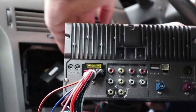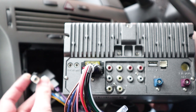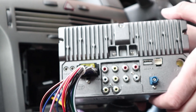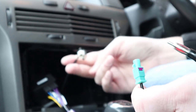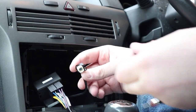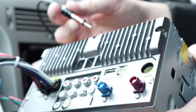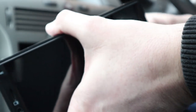On some units you'll probably need to get an adapter for the aerial to fit your car's stereo, and I managed to get an adapter for mine. The aerial connector goes in between - that bit from your car plugs in, and then this plugs back into the back of the stereo. At this point it will just work as a standard stereo for power and radio.